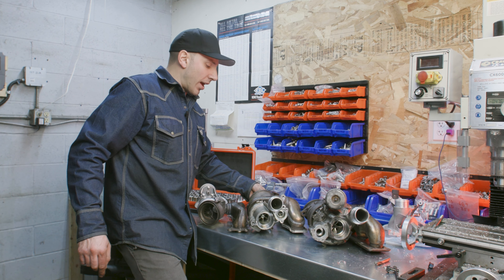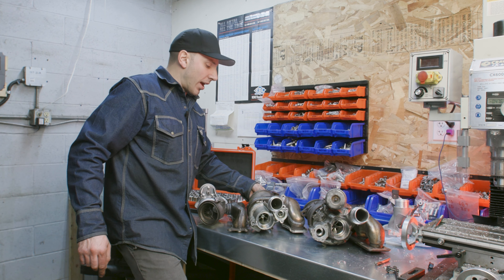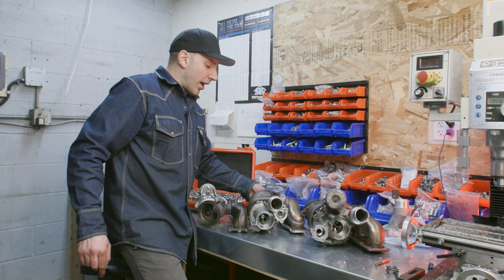We'll go down to a smaller turbo — these are for the N54, the infamous N54. I believe the rattle game all started with the N54. The main reason why rattles happen is because they're vacuum-style actuators, not pressure style. With the vacuum style, the flap starts open; with the pressure style, it starts closed. That changes the whole dynamic of the physics of the arm and where the pressure applies. The reason engineers designed it that way was: if there's an emergency or a leak, the flap is open to bypass the turbo, meaning there's no boost — and that saves your engine. The downside is the bushings do wear faster.